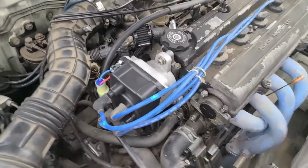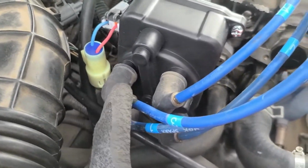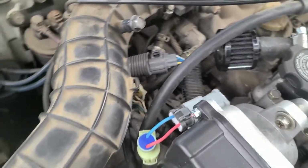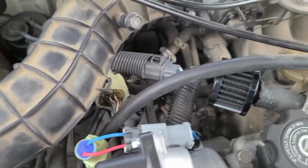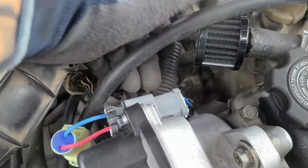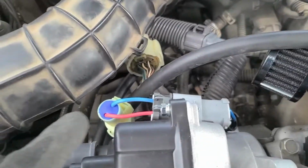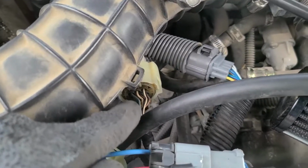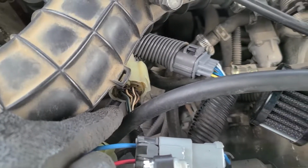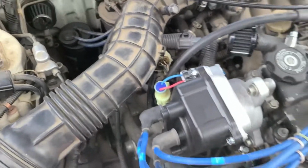All right, the OBD1 distributor is officially in. Just remember the firing order, 1, 3, 4, 2. Have your distributor jumper harness all put away nicely with as few kinks as possible, and if possible, throw in some heat shield or heat wrap. This is what the new wire looks like. That's what the wires looked like since '91, so it gives you an idea what heat, moisture, and all that stuff can do after all those years. Just good assurance.